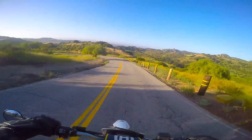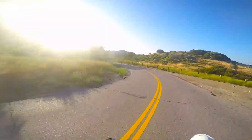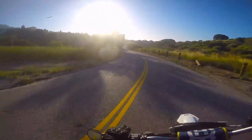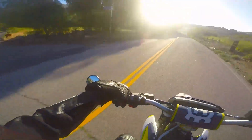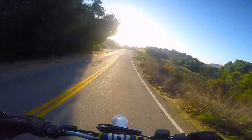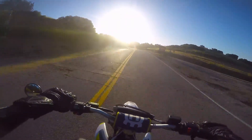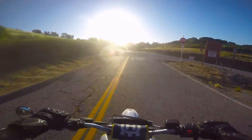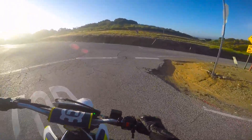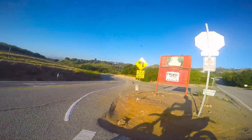Since I'm a light rider — I only weigh 150 pounds compared to the 180-pound rider that they usually set up a bike for — I usually end up taking a couple of clicks out of that coil spring just to soften it up, because a lot of times when I sit on a bike it doesn't even know I'm there.